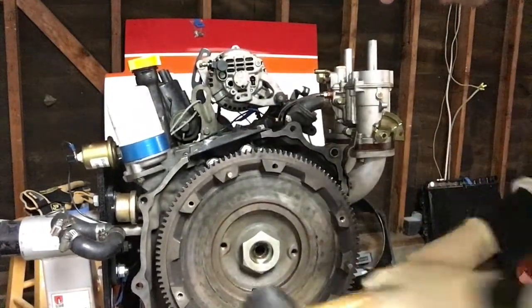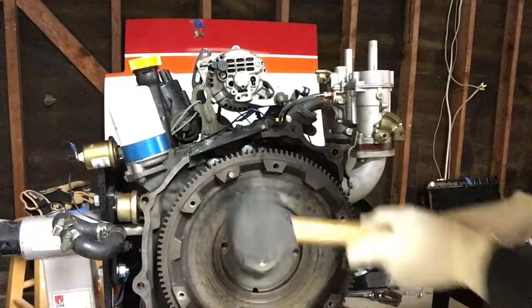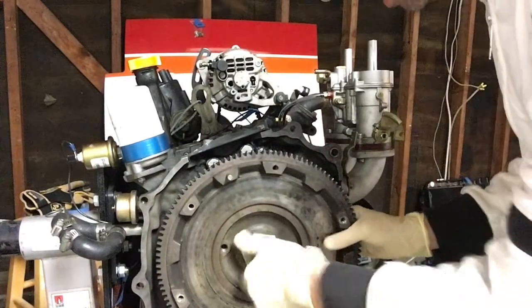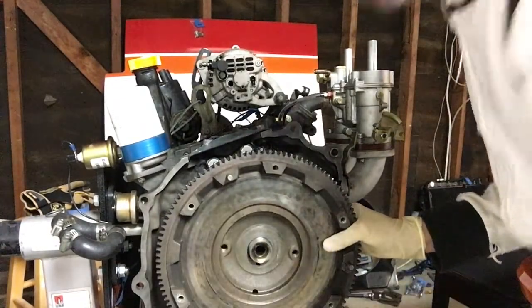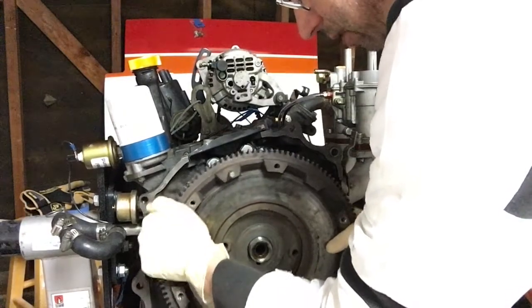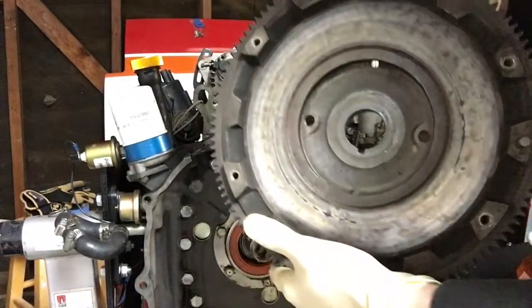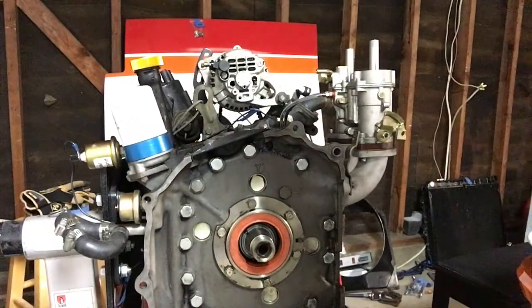You have to get a good whack. Looks like it came loose. So carefully, while holding on to it, I'll spin the nut off, rock it a little bit, and just pull it off. And there we go — flywheel's off. And that exposes the end plate.